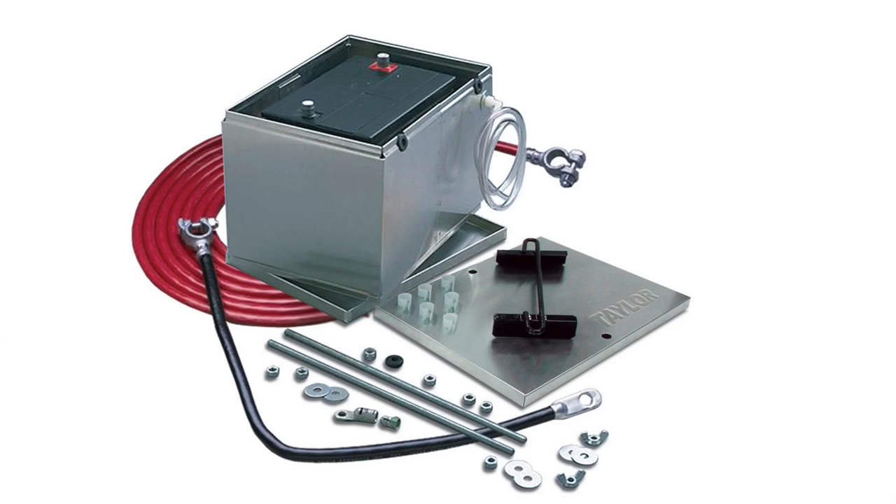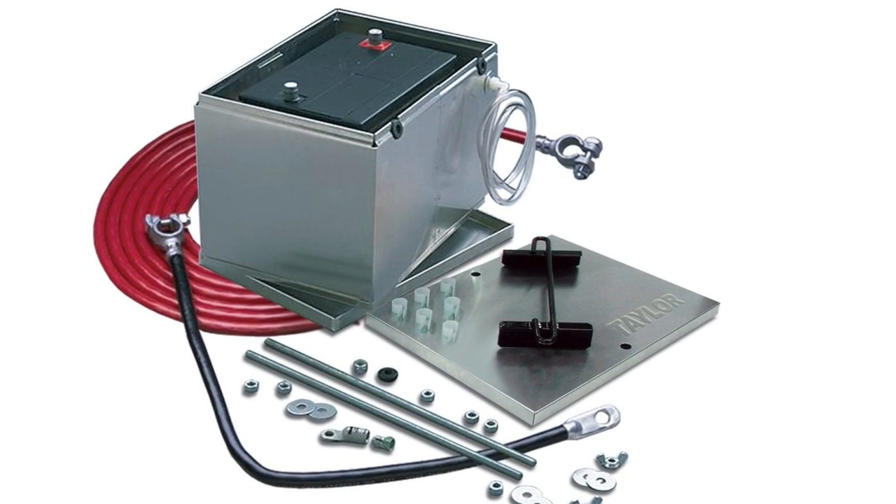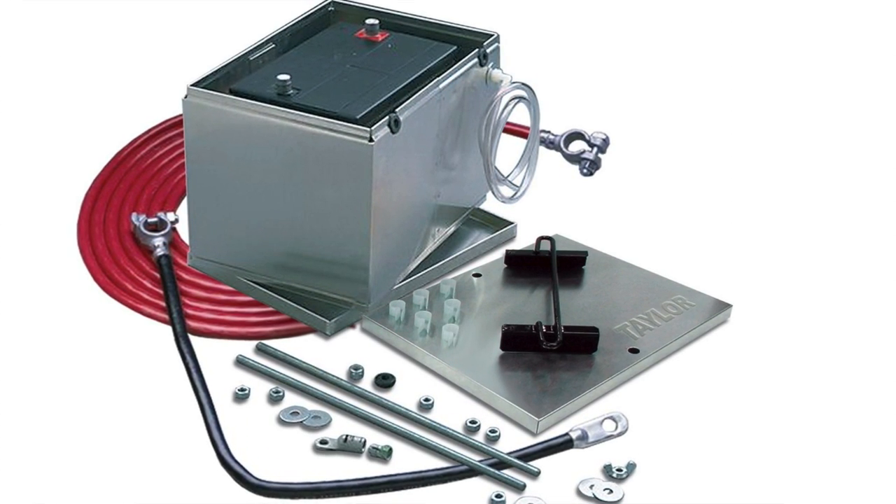On my VR6 Mark 1, I moved the battery back to the trunk. A couple of really important things: make sure the battery is properly secured. I bought a really cool cage and bolted it into the back rail that held the battery. You don't want that battery sliding or bouncing around — it can lead to a loose connection, other damage, or battery acid leaking inside your car.